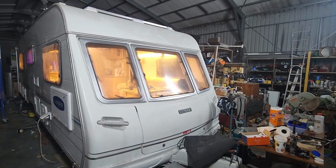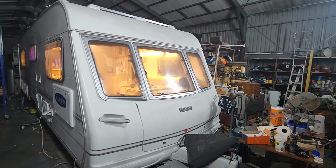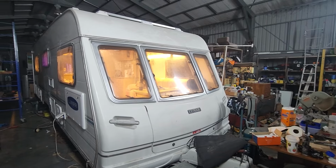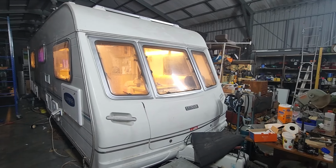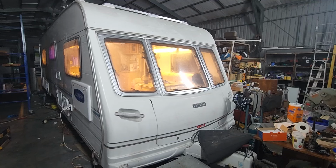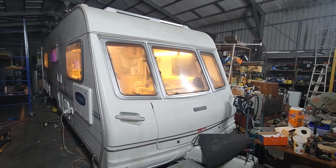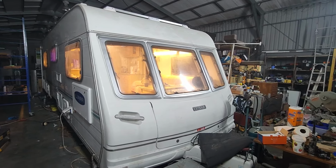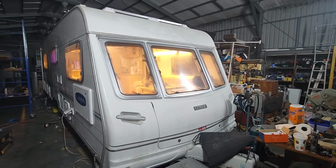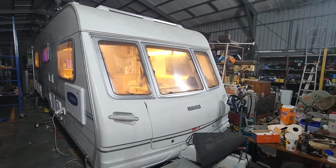Well, today is the day that I post the big update that I talked about in my last video when I had the interior finished. There hasn't just been the interior, but also a number of other things, and that's getting all the windows back in, which didn't just entail simply sliding windows back in. It has entailed pulling windows apart, re-gluing them back together, and then putting them in. That also has involved re-putting the rubber seals in, and before doing that, putting the silver topped tar backed tape down first before the rubber seal.